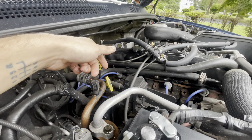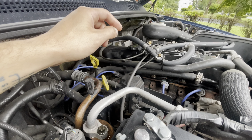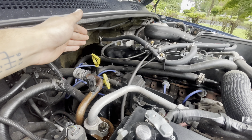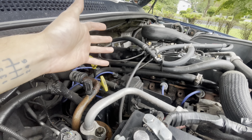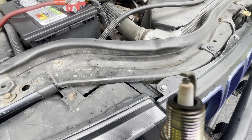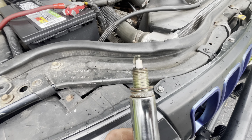I did get the OE Champion plugs. I'll show you guys what plug actually comes from the factory with these Jeeps. Here's cylinder one spark plug — as you can see, it looks really good. Slight brown, no deposits of any kind that look weird. I don't think this cylinder is our issue.